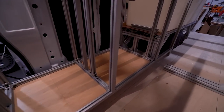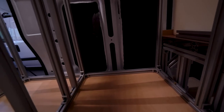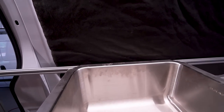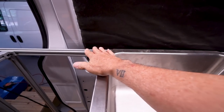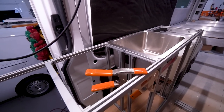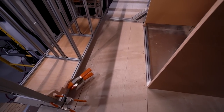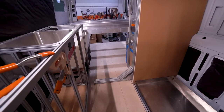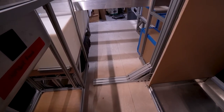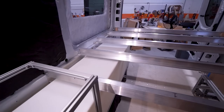We're going to put a little radiator — a two-foot-long radiator — right on the back wall there. We'll seal up the galley so that air gets sucked under it and by convection gets pulled up, heated, and enters the cabin through a grate. It's silent, it's passive, and it will be individually zoned. We're going to have three zones of heat: that passive radiant, radiant heat in the floor as a supplemental to keep your toes warm, and cabin heaters — heat exchangers with fans. There'll be one over here for the office, and one under the bed. You just won't know where the heat's coming from — you'll just know that it's warm.